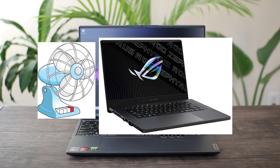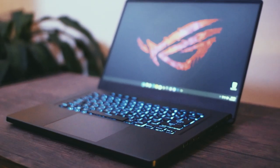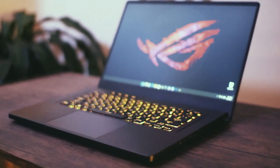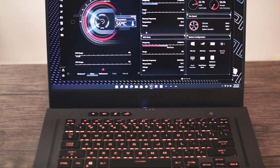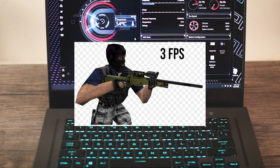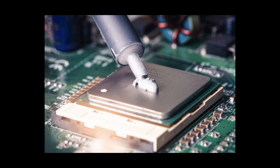Because remember, with increased wattage comes increased heat. So today I'll be showing you how you can flash a VBIOS on the Asus Zephyrus G15 or any similar gaming laptop. This could be really helpful for some people who are stuck getting low FPS in some games, and I would definitely recommend you check out my optimization guide first before doing any of this. But if you've done that and it's still just not running how you'd like, this may work well for you. You also need to be willing to potentially run this thing at max fans or possibly even replace the thermal paste to do this effectively.